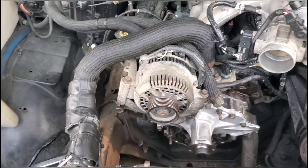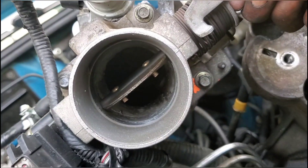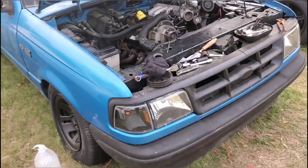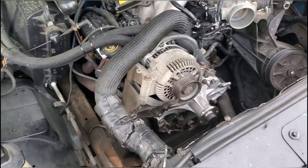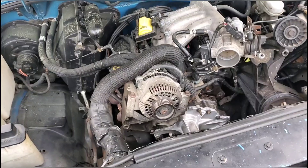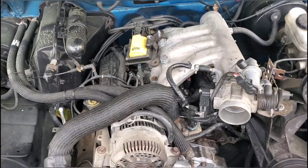The Ranger will be back bolted up soon and I can get back to making some good old videos. But check out this delicious 60 millimeter throttle body — oh, and that smooth transition of maximum VTEC. I did drive it for a time even with the leaking, with the manifold like this. It's a lot more peaky than the other one. Basically all I did was put a 60 millimeter throttle body on a manifold with shorter runners.